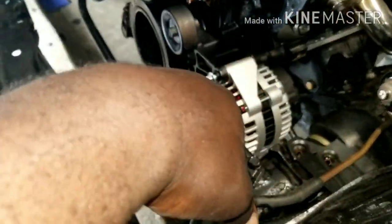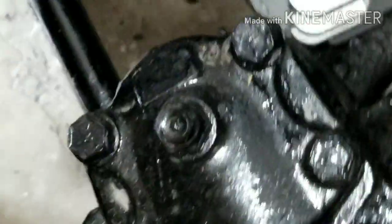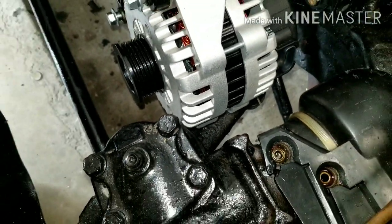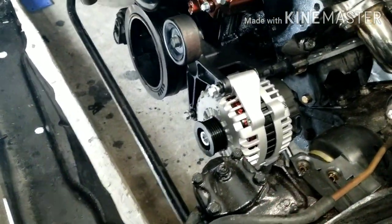Got the Camaro accessories - Camaro alternator. The only thing is this alternator is a little big, I think it's the truck alternator, not the Camaro alternator, so it's a little bigger and you got a little hit right there on the fan. So we're gonna take the grinder and just grind down about two or three fins on the casing - won't hurt nothing, just blow it out with the air hose. If you use the Camaro alternator it's a little smaller and you won't hit. It's like a 200 or 250 amp alternator, you know, for the music.